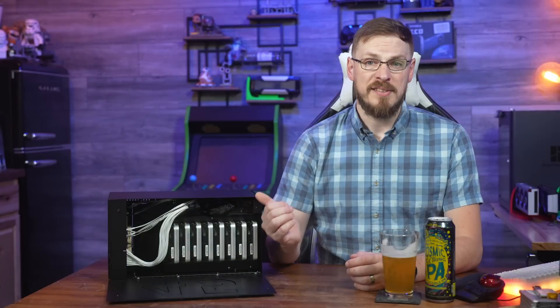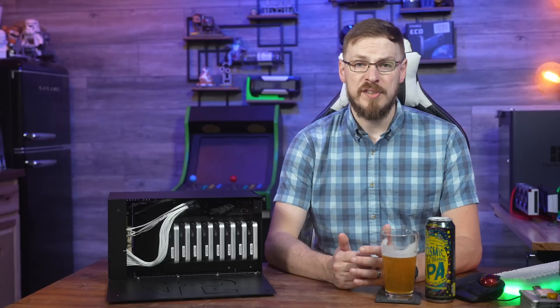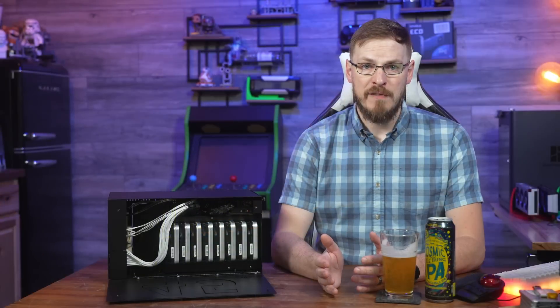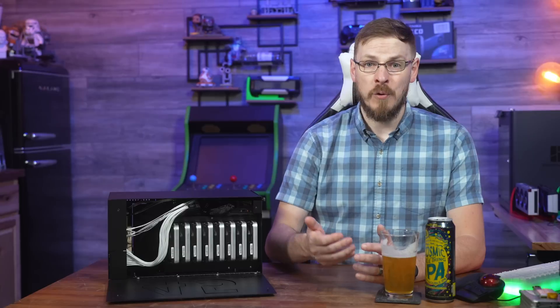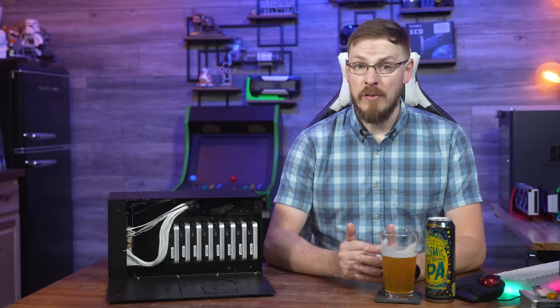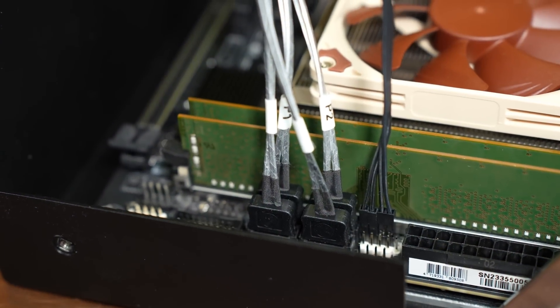In this base configuration, we've got 16 GB of DDR4-3200 unbuffered ECC memory, which I am very happy to see. The system will also support up to 64 GB of unbuffered ECC, giving us more than enough for running a file server as well as virtual machines or container environments. As for connecting all the drive bays, the B550i motherboard has four SATA ports on board. 45 Drives is utilizing a clever card to connect the other four drive bays with an add-on SATA controller via one of the motherboard's M.2 slots. There's a second M.2 slot on the bottom of the motherboard where we've got a 1TB Kingston NVMe drive for storing the OS of your choosing.